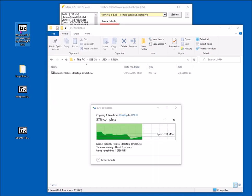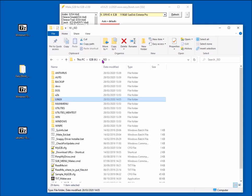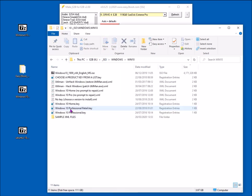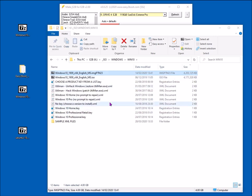The last file is a partition image file — an .imgptn file. If you've got the two-partition system with EFI files on the second partition, use .imgptn23. The '23' tells it to keep partitions 2 and 3 if they already exist — since you want the UEFI files in partition 2 to stay. If you've got existing imgptn files, add '23' to the end. This is a Windows 10 imgptn file — put it in the Windows 10 menu folder and drop it in there.